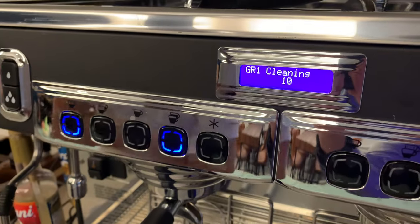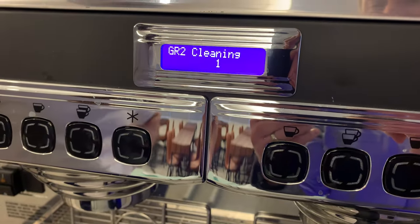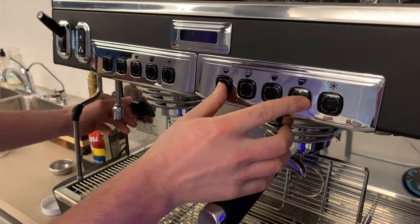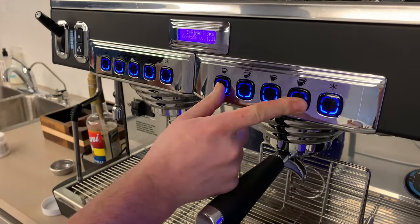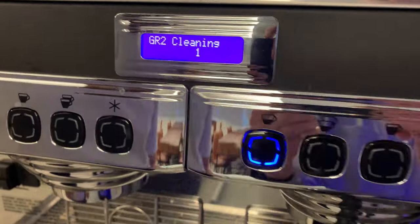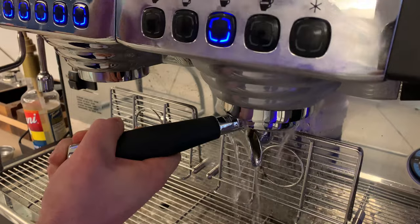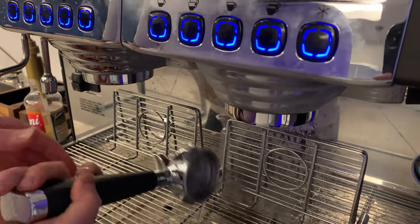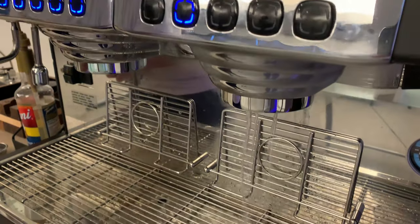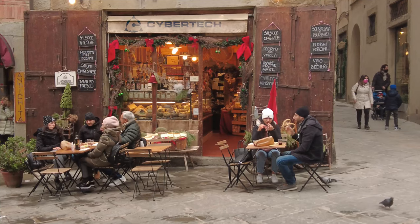Go read the book. When the cleaning countdown is done, do the same thing to the other side of the beautiful machine. When the second countdown is done, the machine is clean. If you want, you can loosen the portafilter and rock it back and forth while running water through the machine. Then run additional water through the machine to really make it clean. You have respected the beautiful machine.